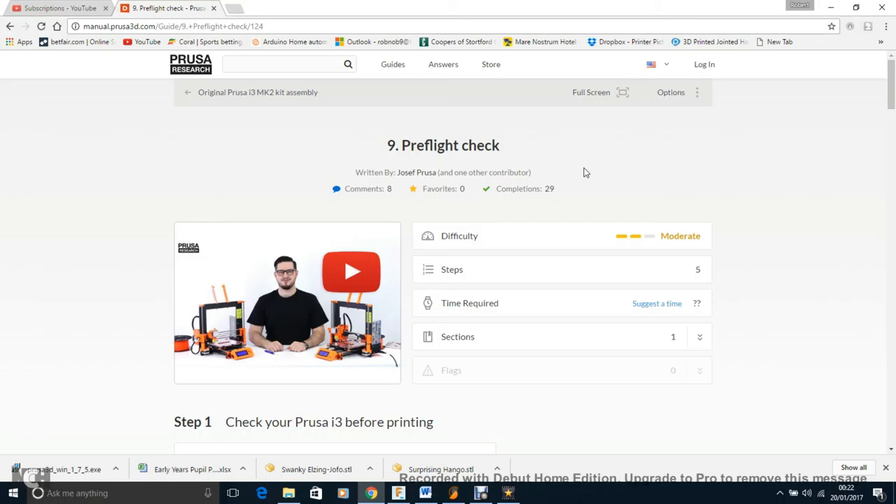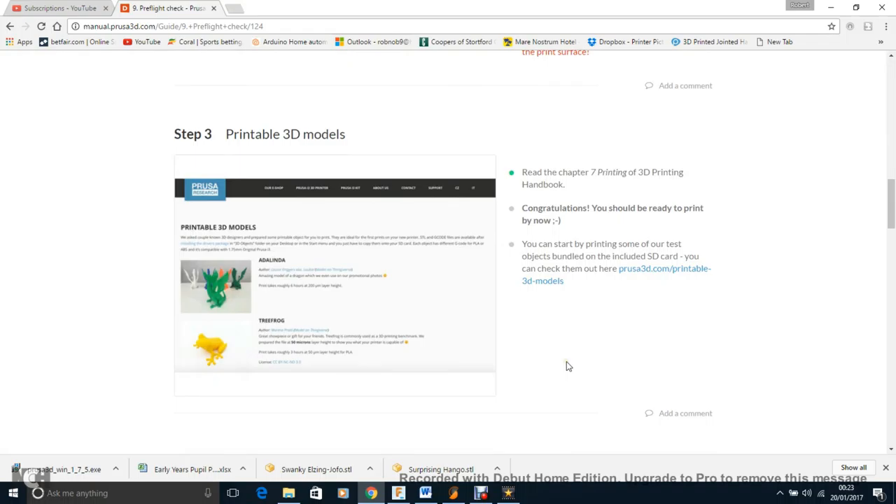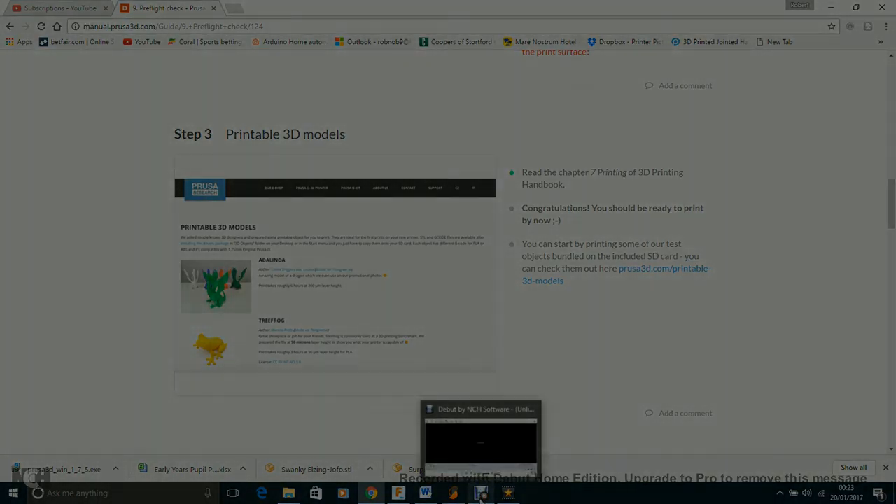Regarding noise: put it on something soft — I have mine on carpet now and it makes such a big difference compared to a hard surface. I might still change the wire bearings to reduce noise further. You can also select silent mode to make everything quieter, though it may print a bit slower. For heavier prints with a lot of movement, you may want to keep it on power mode so it doesn't skip steps. Thanks for watching — I hope this helps with some tips. Please subscribe for more 3D printing videos, and especially more tips on the Prusa i3 Mark II.